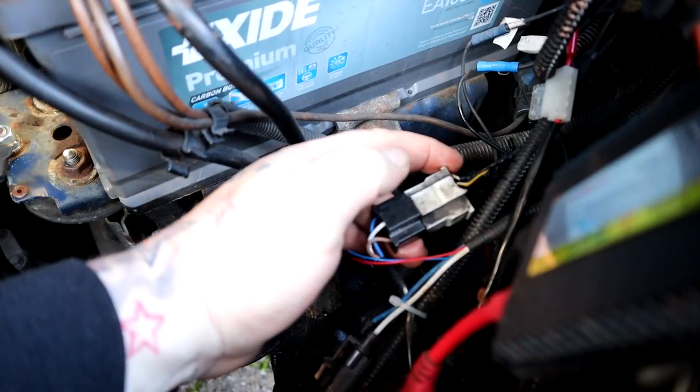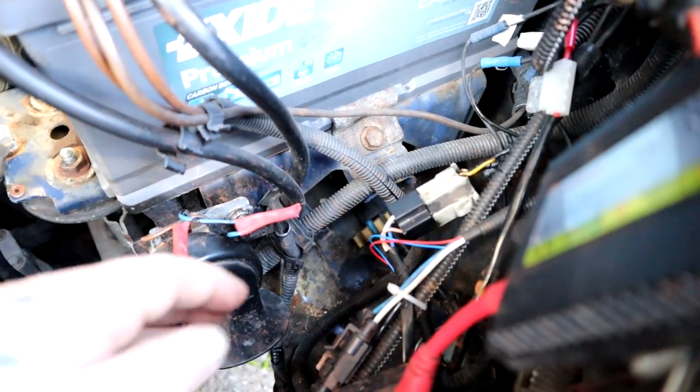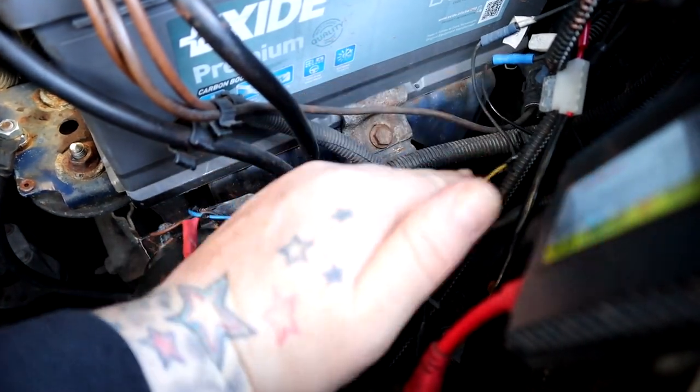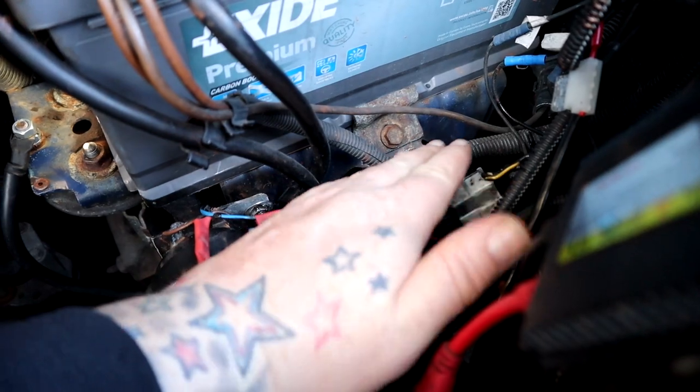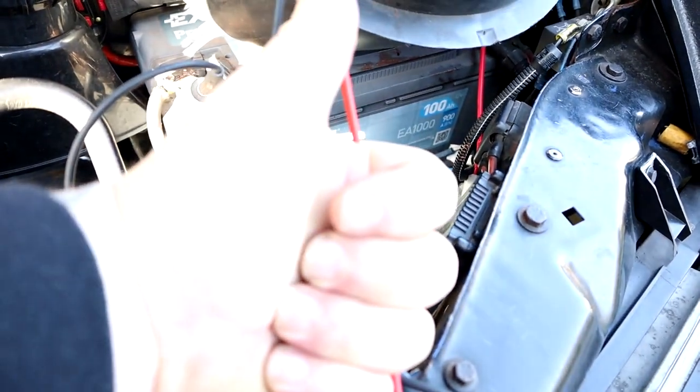We fixed the headlights. That was dead easy. It was just a crappy connection from the main headlight source to the xenons, which is right here. These connections inside were absolutely just not worth a toss. So we've cleaned all them up, replaced them, they're all fine, they're all working great. The lights are now going high and low beam, so that's another job done.